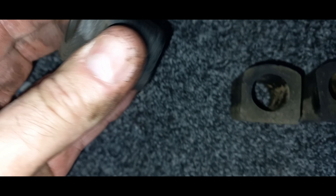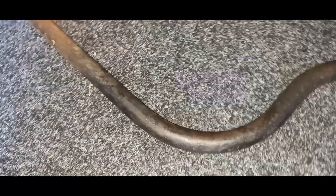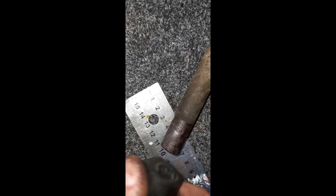These have actually shrunk anyway — all the bushes are shrunk — but they're worn out. We'll give this a clean up. Still considering whether I should paint it. We'll clean all these housings for the bushings. You can see here — that's the old bushing and this is the new bushing. It's 19mm — I've just checked it. It's going to be tight getting it onto the bar, but we'll get it on. Might have to get some silicone spray on there. It's just getting it over the end which will be interesting because she's pretty tight, but they're supposed to be tight. There's major wear on these old ones.